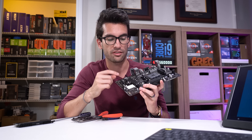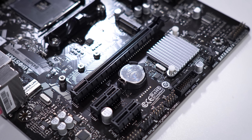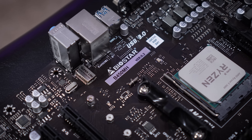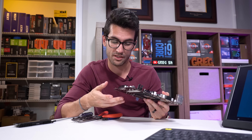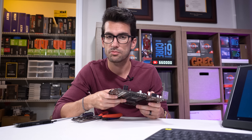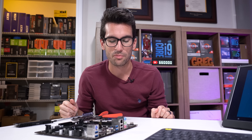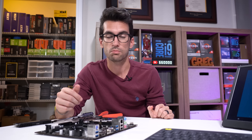It's very difficult to get that little splash screen to pop up, but once I could get it to show up again, I got the exact same 'CMOS error' message. It's not a very common issue, and it's not very common that BIOS chips just go bad. If I had one on hand, I would desolder the one on this board and swap it out just to see. But if it's not the CPU, not the RAM, not the power supply — it's something on the motherboard itself, and you can't see any physical damage. I'm concluding it's a bad BIOS chip because I have no other explanation. The board is pretty much bricked.